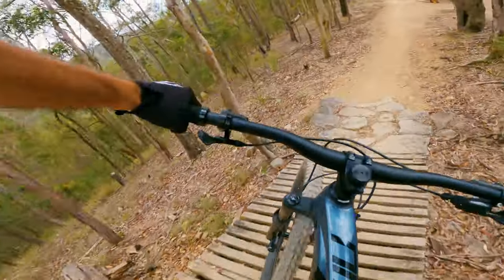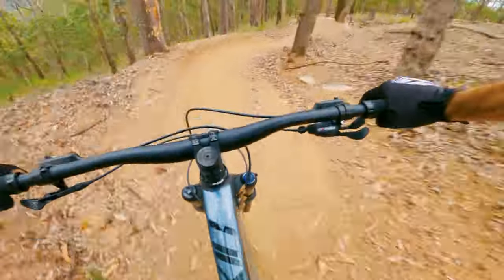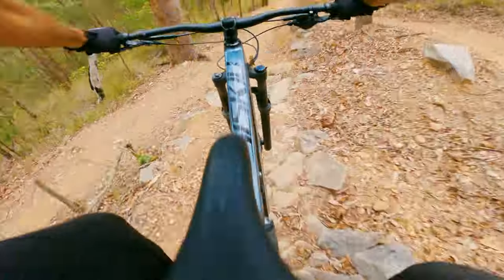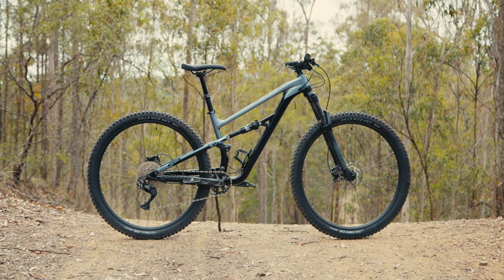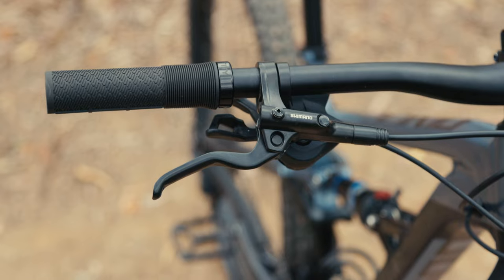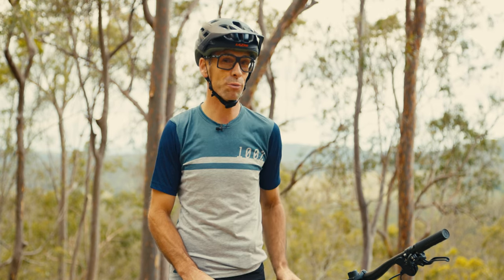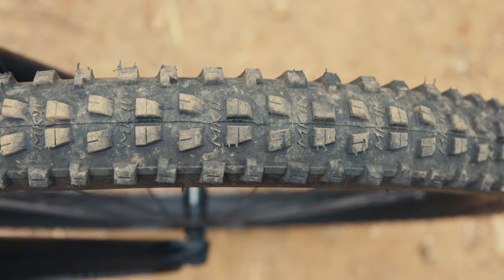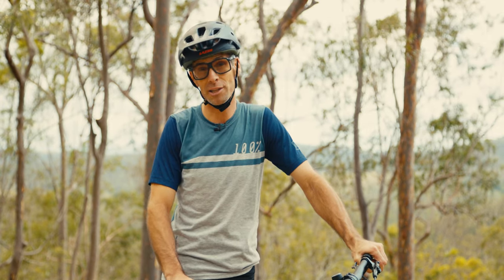In terms of changes I'd want to make, I'd possibly swap the handlebars to something with more sweep — that's a personal preference, but I've found the bar shape on the two Polygons I've tested recently isn't the most comfortable for me. I also found the braking isn't amazing on really steep terrain. On most blue-rated trails they're fine, but the two-piston MT200 brakes with basic metal rotors and resin pads and 180mm rotors were a little out of their depth on steeper trails. As a first step I'd look to a better rotor and pad material, but you may want to look at a brake upgrade down the track — or consider the T7, which has a four-piston brake on the front wheel. The other change I'd make is setting the tyres up tubeless: you'll get more out of your tyre and wheel setup, better reliability, more wiggle room running lower pressures, and you'll drop some weight too.